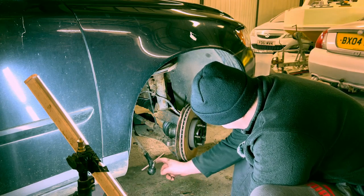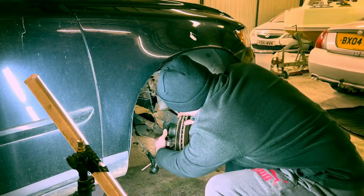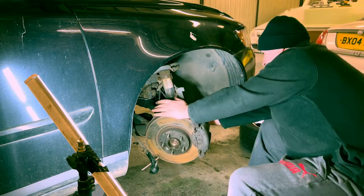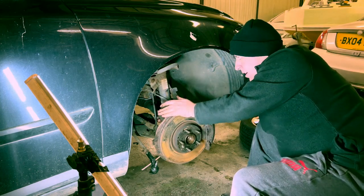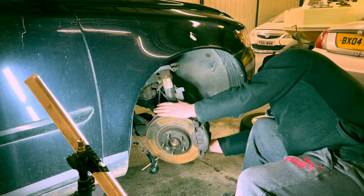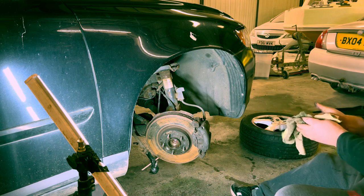It came out and we didn't split anything, so that was nice. You can see this drive shaft gate here — there's not even any attachment to it at all. It's literally just been spinning — you can probably hear there's quite a lot of noise and movement in that drive shaft. So the next thing to do is the same on the bottom one down here, which has a much bigger bolt — I think it's a 19mm — so I'll get a spanner for that.